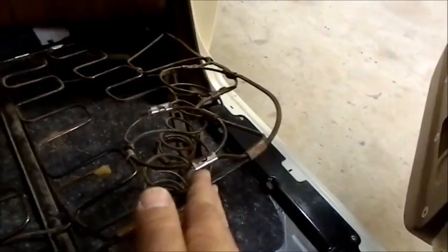I was going to do the trimming in this chapter but I decided not to. This is absolutely terrible — it's not looking at all like I want it to. A lot of this wrinkly stuff is due to the way the cover's fitted. When I took the original cover off I was surprised there was no slit in the foam for the listing — the listing is a little calico envelope which those wires go through to give it that pulled-in look. This cushion frame doesn't go back far enough — it's sitting right out here and hard up against this area. This looks to me to be a ZD Fairlane one, which would explain why there are no cuts in the foam, and also why it's hard up against there, because ZD Fairlanes have a longer wheelbase and that dog leg is further back.